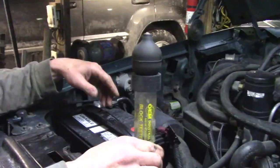After the block test we're gonna do a compression test and a leak-down test. We're gonna pull out the spark plug that was put in new to see what it looks like now, then do a compression test - that'll tell us if we're leaking through the head gasket. Also, cylinder 4 is where the spark plug was messed up, and on a straight six that's in the middle of the head - the longest length. If you're gonna warp a head and blow a head gasket, it will happen more in the middle because that's the longest plane for it to separate.